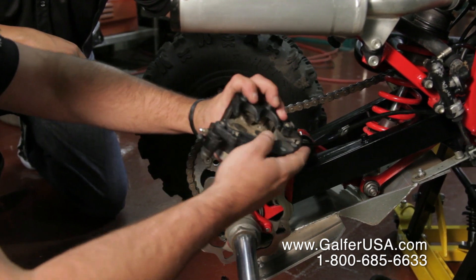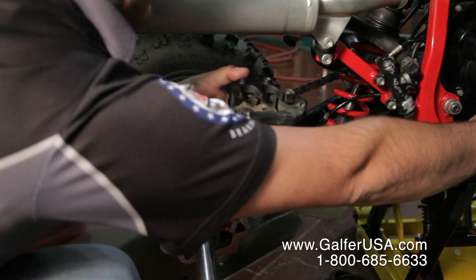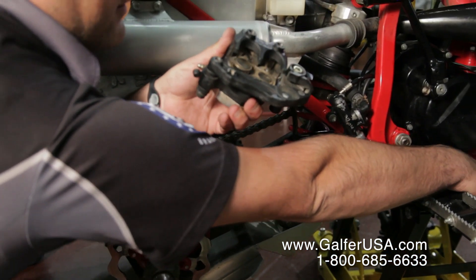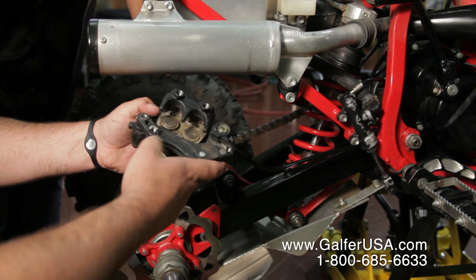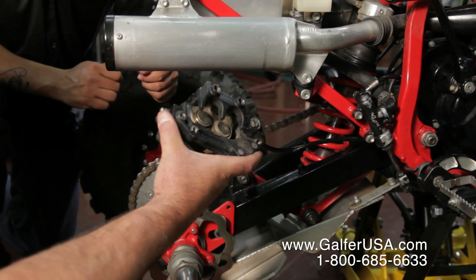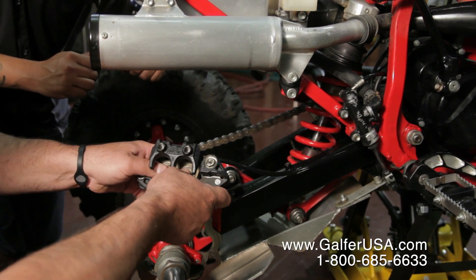How do you know if your pistons are very dirty? You're only seeing part of it. You can go ahead and pump on the brake lever a little bit and your pistons will come out. Once you see that your pistons are dirty or not, go ahead and clean them if necessary. Do remember, you've got to push the pistons back down.